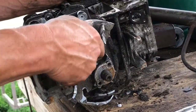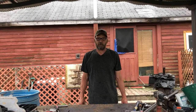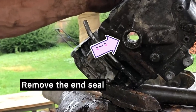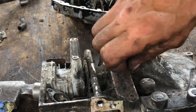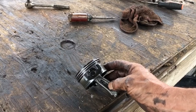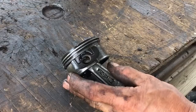I still have a few bolts on this bottom housing to remove. Some of the methods may seem a bit unorthodox — we're not trying to rebuild the motor, we're trying to recover aluminum for scrap. Whatever measures it takes to get the aluminum off the scrap. You've got a metal plate with four quarter-inch bolts to remove. Then we've got to remove the rings and the wrist pin — there's a little clip right inside that you take out with a screwdriver.